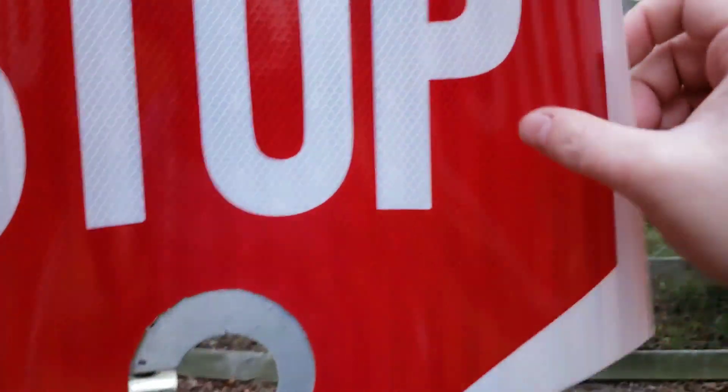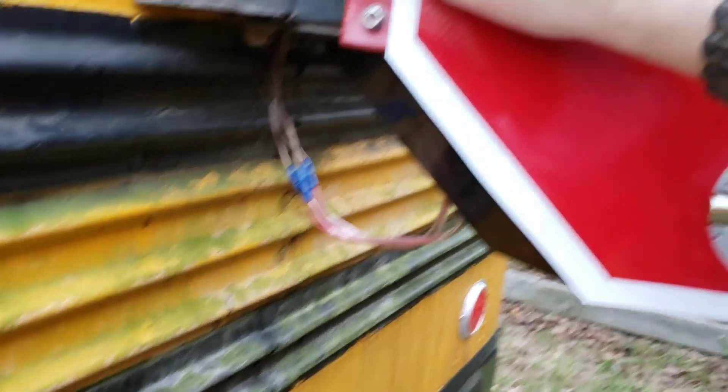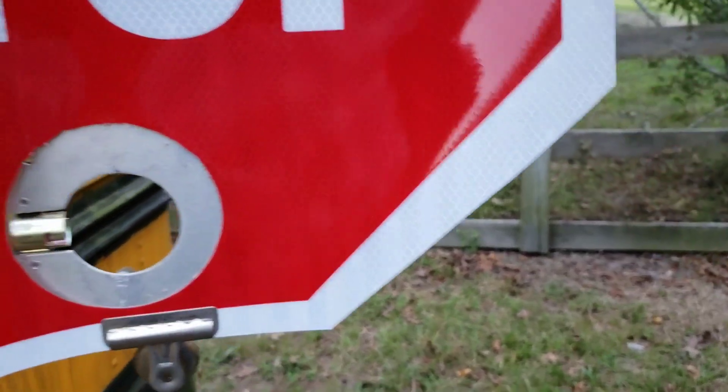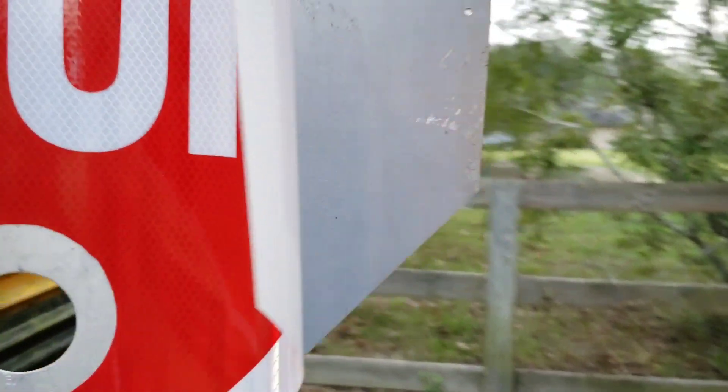Okay, so I've got all the red off of this stop arm. I've got the new decal here. These guys come cut as a square or screen printed onto a square. So I'm just trying to get it pretty close to where it needs to be — it may have a wider border on the right, but it's going to have a good uniform border. I tried to get this as clean as I possibly could because you're supposed to put the 3M stuff on clean aluminum. I ran out of brake clean, but this should be fine. So I'm going to peel the backing — I do apologize, this is hard to do one-handed.